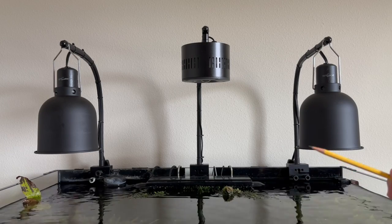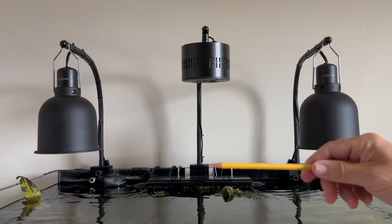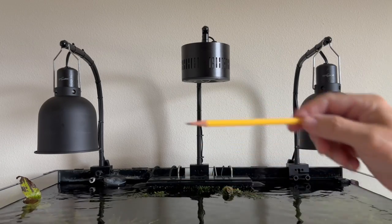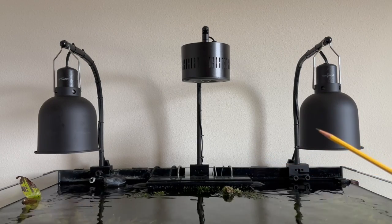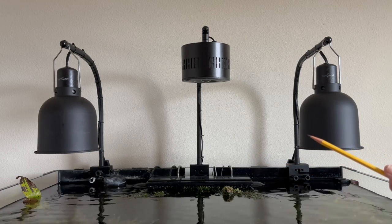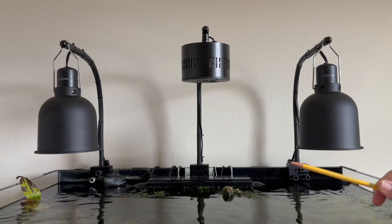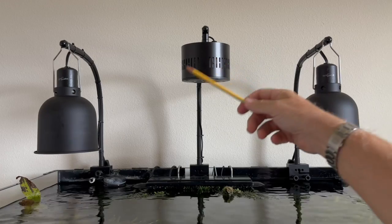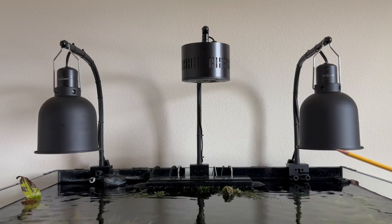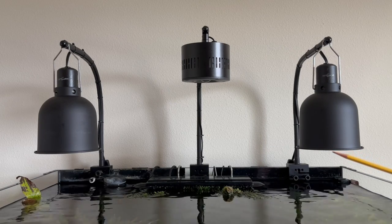If you go out and buy hundreds of thousands of these defective LED dies, they're going to wind up not lasting as long. Both lamps that I had had the same problem — one of the LEDs just quit working. So apparently that is the problem, that's why the fan runs. It could still light up, but you would have to either jump the LED or unsolder that LED and put another one in that spot. You can order LEDs off the internet, but if you replace that LED, you don't know if any more of these LEDs are going to wind up burning out. So that's just keeping price down.